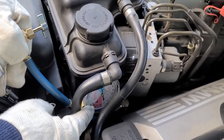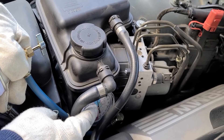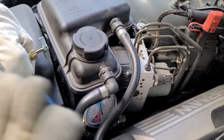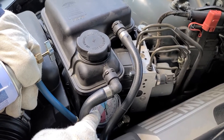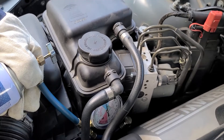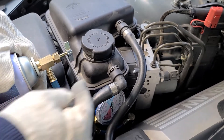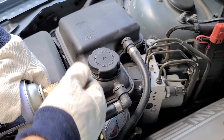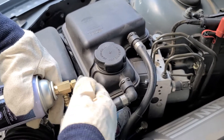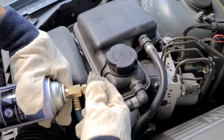You can see your gauge here — I'm in the blue area. I actually have some refrigerant but I need to charge it a little bit. I'll show you the process. Usually when it goes down below into the white area it blows hot air, but mine is not too bad. I'm going to add a little to show you the procedure. As soon as I close the valve here, that needle will make a hole inside on the top of the can.